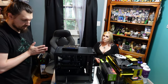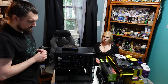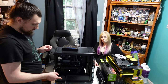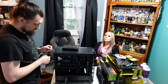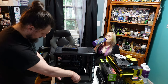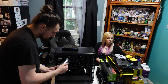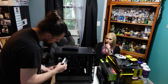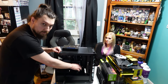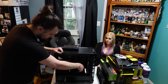Oh yeah, this Titan X Pascal had some modifications done to it. It's using a little NZXT mounting bracket to convert from a CPU AIO cooler to the GPU die on the Titan X. I don't remember which cooler this was. I think the only requirement is that it has to be an Asetek style mounting bracket. This one, it looks like it's a 120mm EVGA.